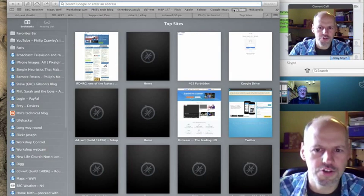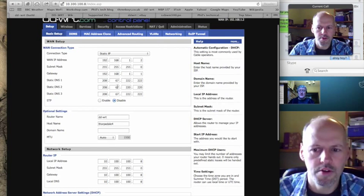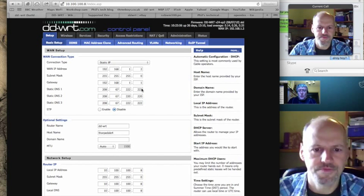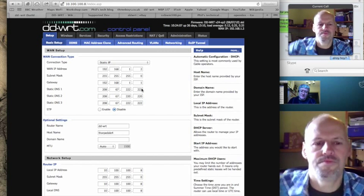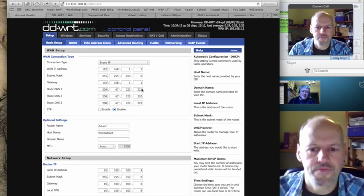I see you're showing me your router interface there. Is that also your modem? No. Because I've got ADSL, pretty much all the DD-WRT routers, well, all the ones I've bought, there must be some that have an ADSL interface on them, but all the ones, maybe the half dozen that I've bought for family use and for other people, they've all been Ethernet. So they assume there's a cable modem or an ADSL modem hanging off them.